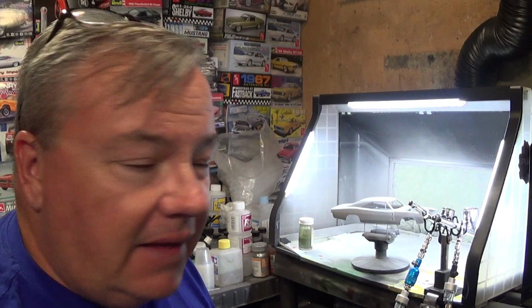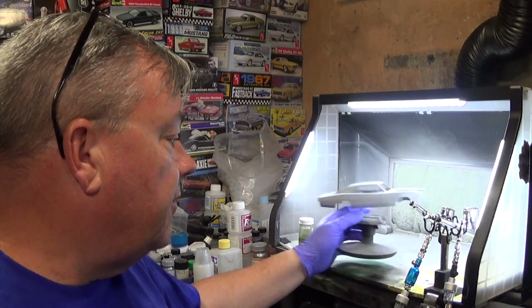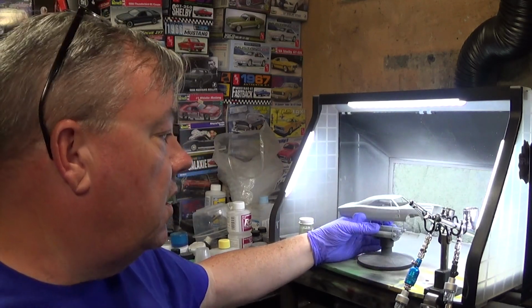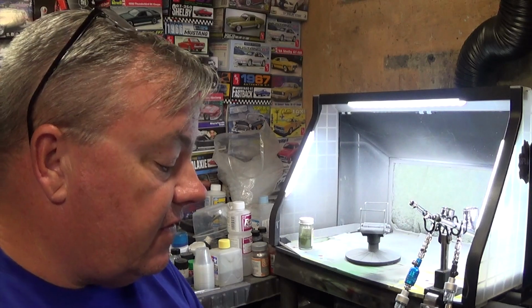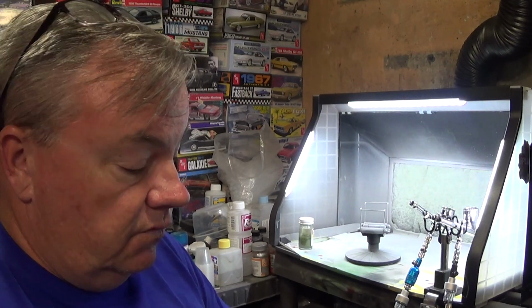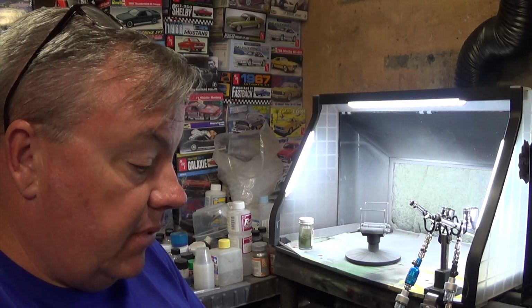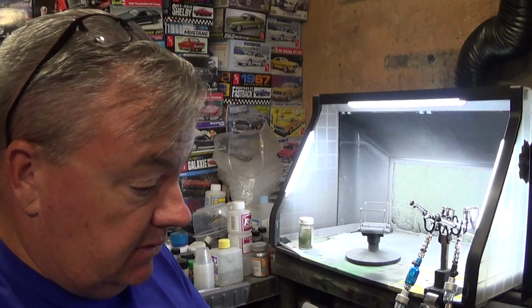It's regular painting, but painting a body naturally has its little quirks that we have to go over. So the first thing I'm going to do is grab a tack cloth. You've seen me use these before. It's cheesecloth impregnated with a wax that will pull solid contaminants off of the surface, like dust and really big chunks. Down here it's almost like a wasted step, because this is the dust nexus of the universe. But it's a step in the process, and it might help you.